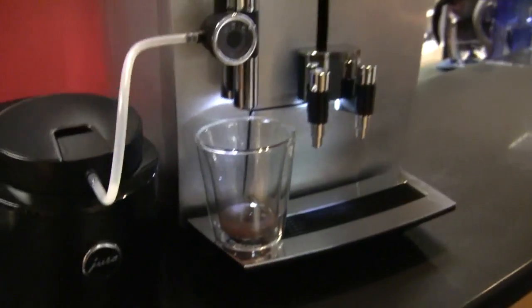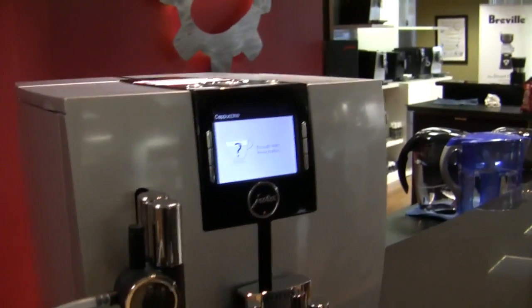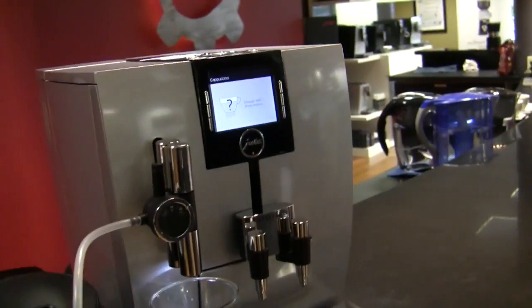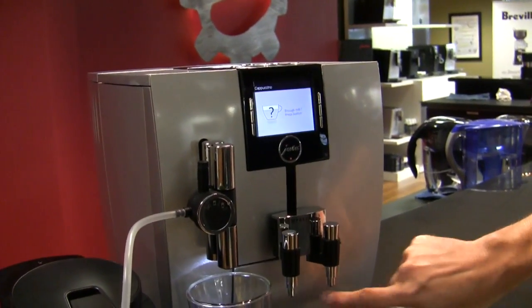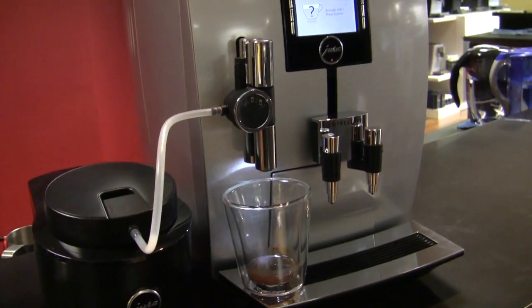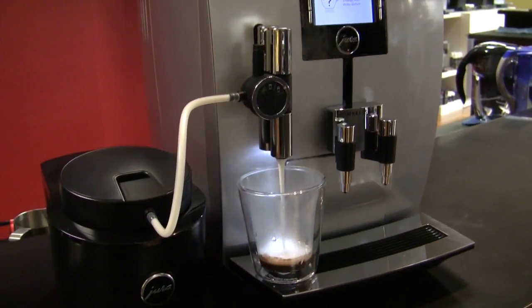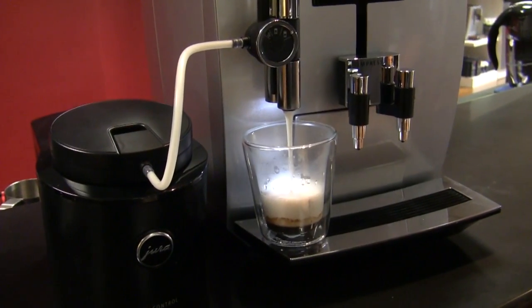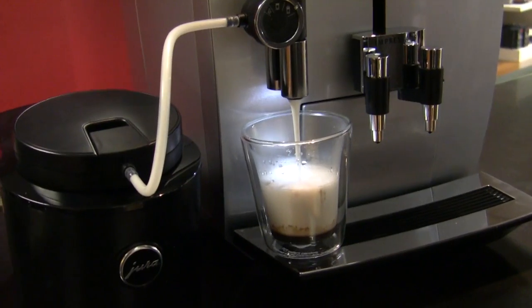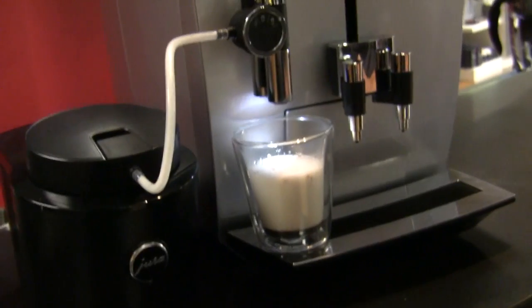While I'm doing it, I'm also going to program the volume on the cappuccino button. Did you do that by pressing down? Push and hold — there we go. It's giving you the business. I noticed it wasn't quite seated in there right, so I'll have to figure that out. Look at that foam though! When I have enough foam I'm gonna push the button again and it will remember that portion.